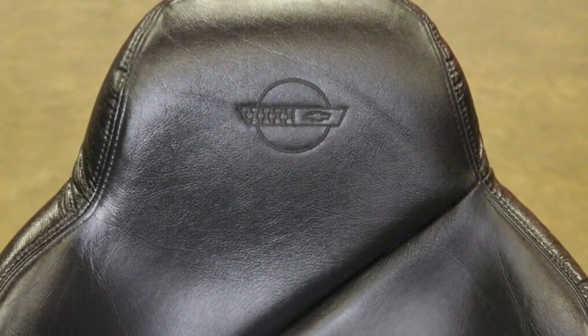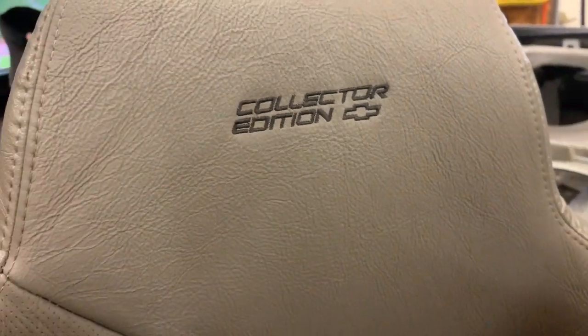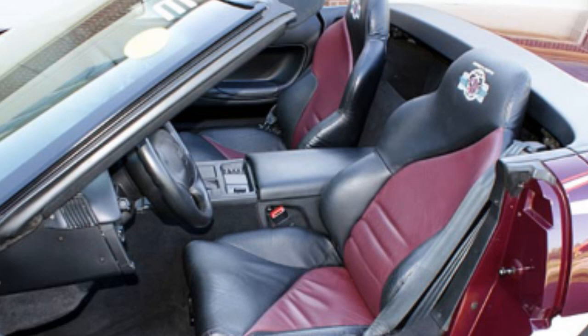One other thing to mention for the 94 to 96 sport seats: there is an emblem embroidered in the top headrest on all sport seats 94 through 96. However, this embroidery changes in 96 with the Collector's Editions and also the Grand Sports, which each have their own respective embroideries. There was also one other seat design in 1995 for the pace cars — a sport seat design with special coloring for those cars only. That brings us to the end of our video covering all the different seat styles originally offered for C4 Corvettes. If you have any further questions about seats or anything else for your C4, please check out our website at miroccorvette.com. Get in touch with us and send us an email — we'd be glad to help you out with whatever parts or components you're looking for. I hope this video was very informative and that you enjoyed it. Thank you for watching.